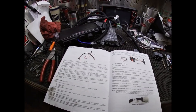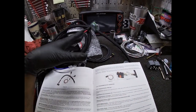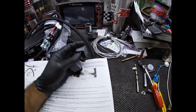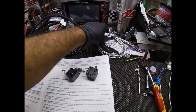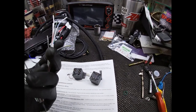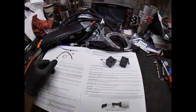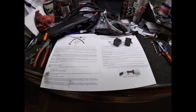Just got a few things left to wire up. Tomorrow I'll get the ECU mounted, hook up the main battery power, connect vacuum to the manifold port, and wire in the fans. I'm going to use the stock Camaro fan relays and tie into the input and output wires — I think it's the gray and the gray/red wires — so I can run the factory F-body fans, which work great on these cars. That'll wrap it up and then we'll come back with Part 2 for finishing the installation and getting into tuning on the Terminator.